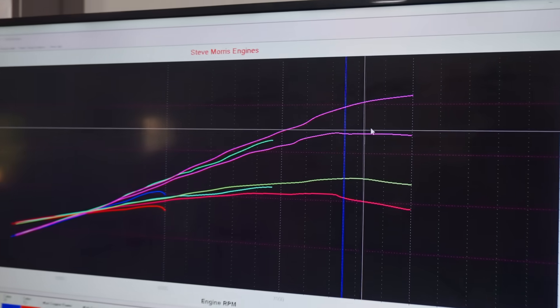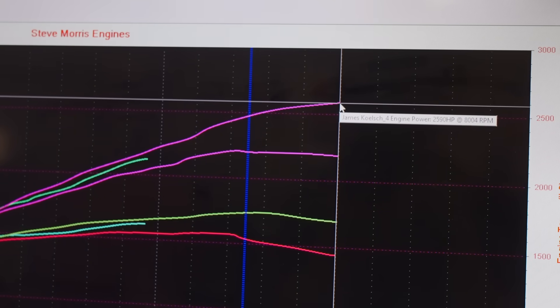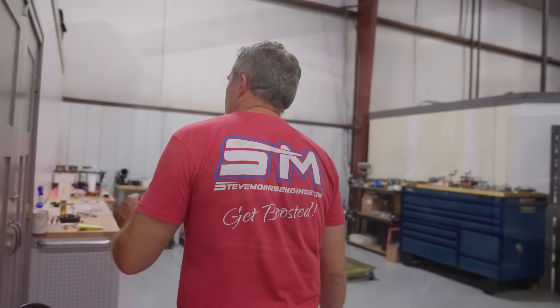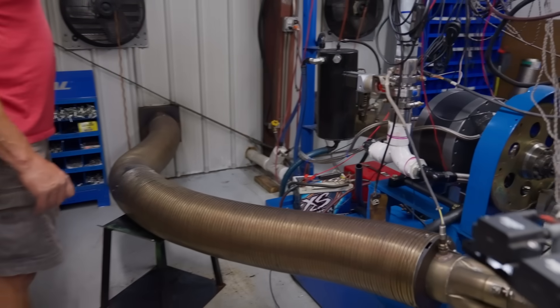This right here is a difference of 2,590 — let's just say 2,600 — to about 2,200. That is a 400 horsepower improvement with a couple air fuel ratio points and a couple degrees of timing. The stuff gets really really good. That's why it will make more horsepower. I used to lean on the stuff and get bigger horsepower numbers but I don't care anymore. Engine's great, it will make horsepower, everything's awesome right there. Sort this thing out on track, no big deal. But we're going to go figure out also what's going on with the dyno since it just blew that out.